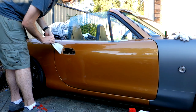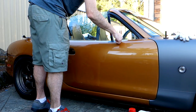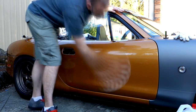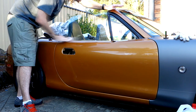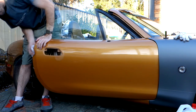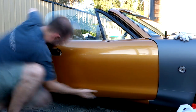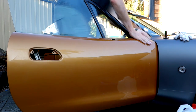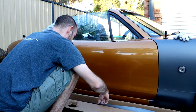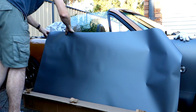If you are taking ages to wrap your car like I did, it's a good idea to tape over any openings to the outside so you don't get bugs and moisture inside. Here I'm just pulling off the gaffer tape I stuck over the door handle and the hole where the mirror would normally go. Next we're going to want to clean up any tape. As with the door handles, preparation is absolutely key here — go over the whole thing with some isopropyl alcohol and a nice clean applicator pad, really give it a good scrub. If you don't get this part right the whole job is going to turn out rubbish. I spent probably a good 20 minutes getting into all the little nooks and crannies making sure everything was absolutely clean before I started.